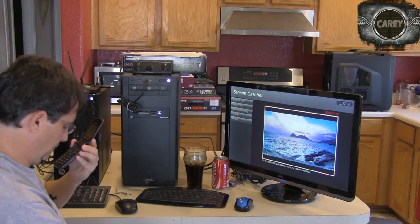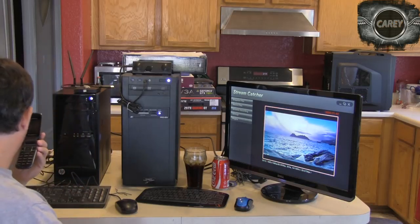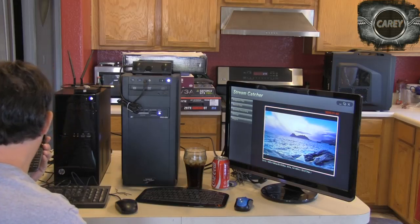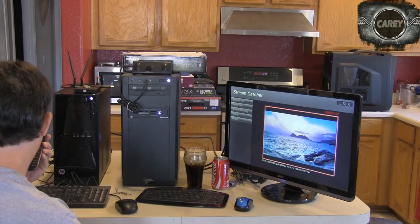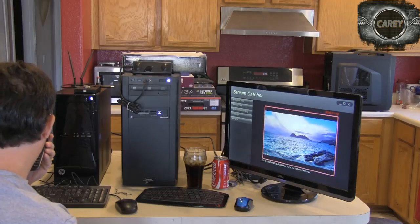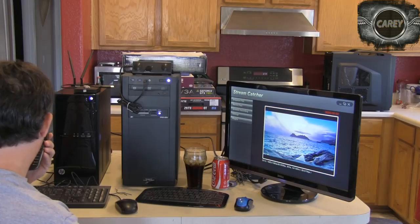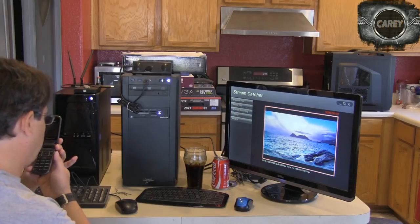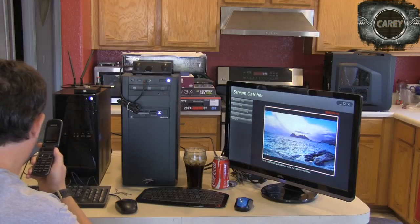Okay. Now, you need to have a look at your keyboard, alright? At the extreme left-hand bottom corner of your computer's keyboard, can you see a key that says CTRL, as in control? Yeah, sure. Now, beside that, can you see a 4-flag Windows key? Yes. Now what you simply need to do is press and hold down the 4-flag Windows key with one finger, alright? Press and hold it down. And with another finger you need to tap the letter R, R is Romeo, alright?